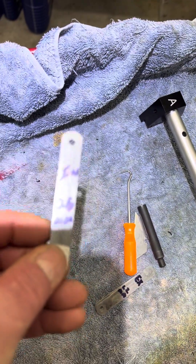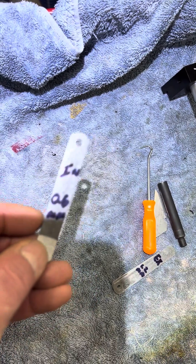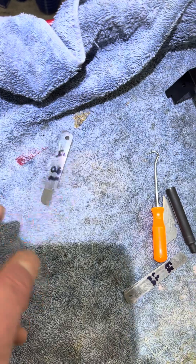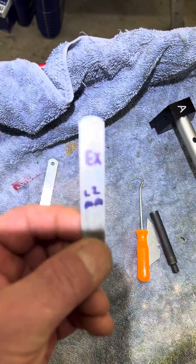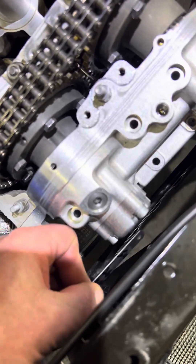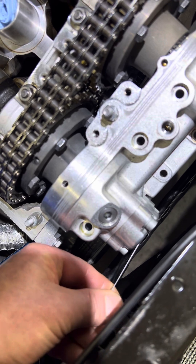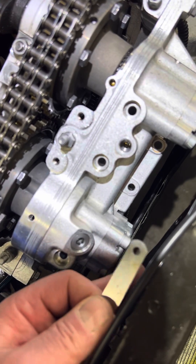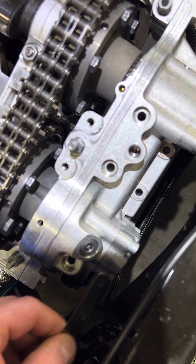What I found is that the measurements are different. The intake piston sits about 0.6 millimeters before the complete end of its bore, and the exhaust is about 1.2 millimeters. So with the caps off, there's a bore the pistons slide in, and you can measure how far the piston is from the end. That's where it's completely butted up against the stop in the cap — that's where it needs to be.